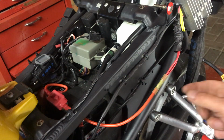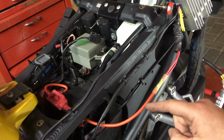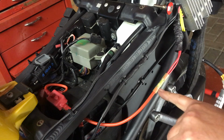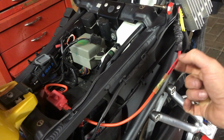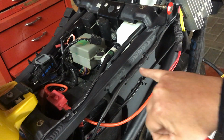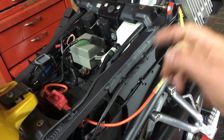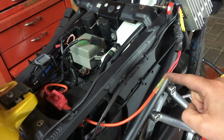Anyway, right. So two red wires, two black wires have got to go into a single wire. So as you can see here, that's what we've done, we're splicing them together. I've just crimped this side, and now I've just placed those in. I didn't want to get ahead of myself, I just wanted to make a quick video of this because I've already done the negative wire. Now you can see there, it's all been crimped up and heat shrunk with the heat gun. Okay, so that's the next step on this particular one.